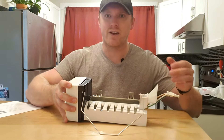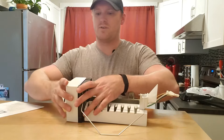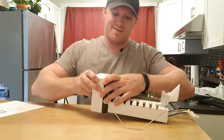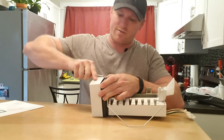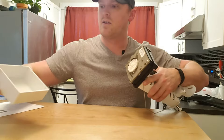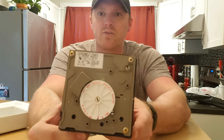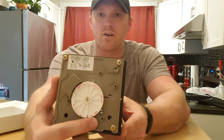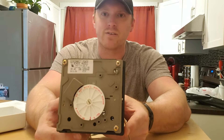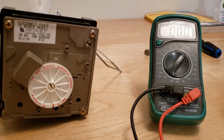That's it for the really easy checks. Anything a little more complicated, you're going to have to get into this. So we'll pop the head off — it just pulls off, sometimes it can be a bit of a pain. You can take a flat blade screwdriver or pick and just pop this little white cover off. What we have now is the head of the ice maker. You'll notice there's a bunch of little holes right here — these are where we're going to be testing to check the power and check resistance, things like that.